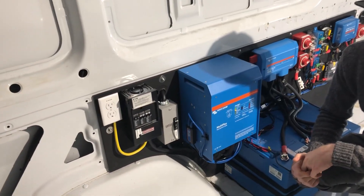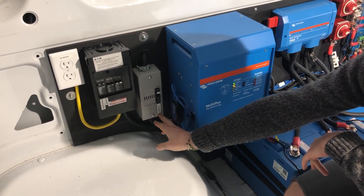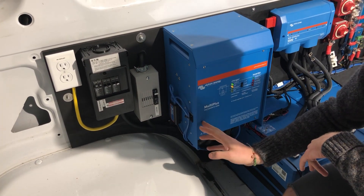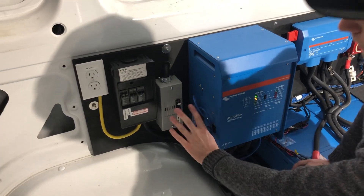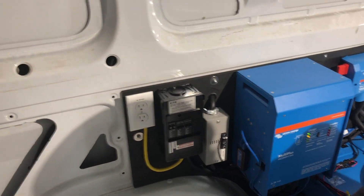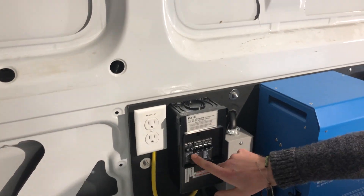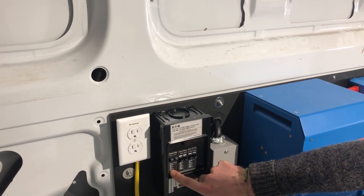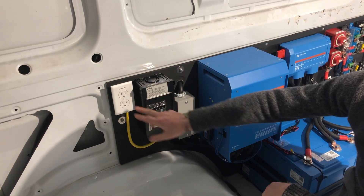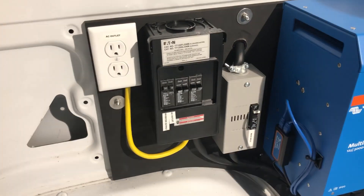The next step is the AC system — similar to the DC breakers. This is our main input, coming in from shore power or a generator before it goes into the inverter. This DIN rail breaker is your main off for incoming AC. After it goes through the inverter — pass-through or the inverter running — it comes out to the inverter output. We have a 30-amp breaker there, and right next to it a 15-amp running this AC outlet, so you can turn off the outlet or the inverter output. There are a couple other breakers currently unused since this van is just an empty shell, but there will be more.